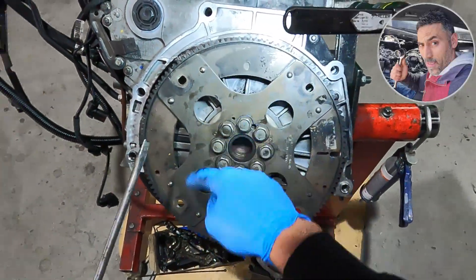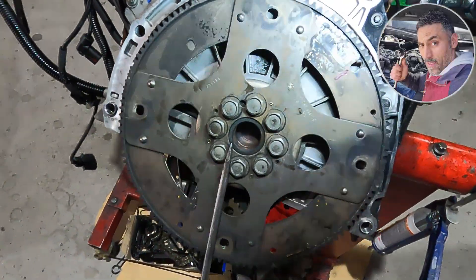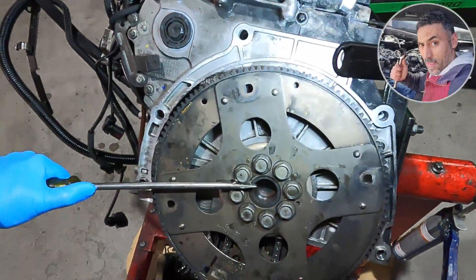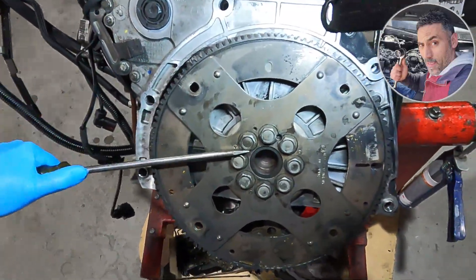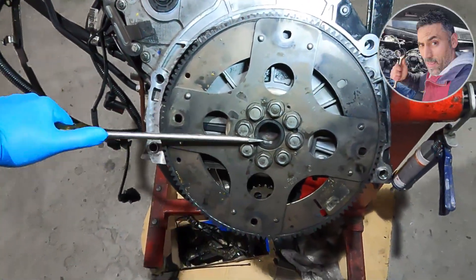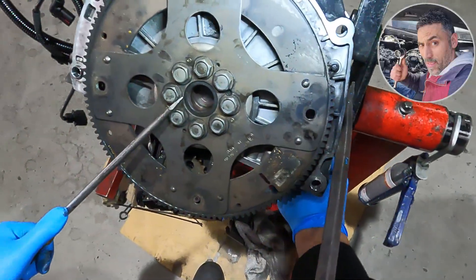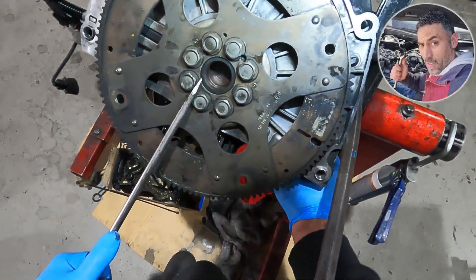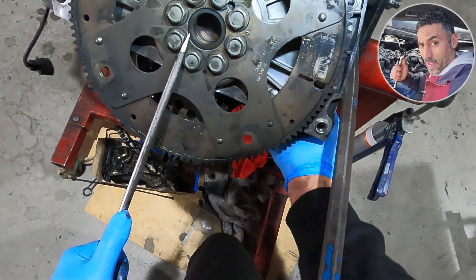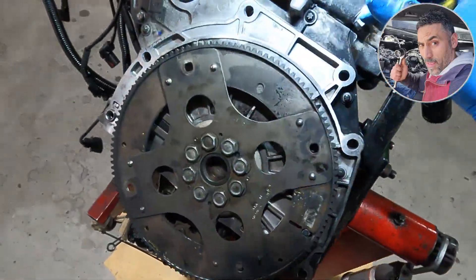I'm telling you — when I am on the flywheel side I turn it to the left, which means the front of the engine is turning to the right, because the tensioner is in a different position in this engine since the chain is between the gearbox and the engine. I do one full turn — push it this way so I can put the pin on. That's it, the pin is on, and the timing marks on top should fit very easily.